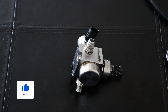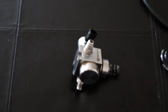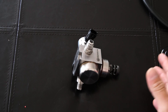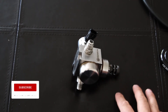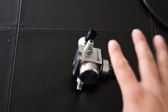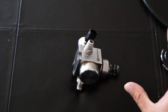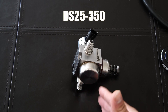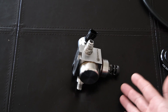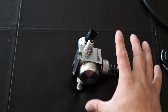One product I want to mention that was kind of unexpected is the high pressure fuel pump for the Gen 2 B58. It's significant because from the moment the Supra came out nobody has been able to make a high pressure fuel pump that will support that fuel system. The fuel system for the Gen 1 B58 runs on a 200 bar system — about 3,000 psi. The fuel system in the Supra and Gen 2 cars is a 350 bar fuel system, around 5,000 psi. That's why the new fuel pump for Gen 2 is called the DS25 350 — operating at 350 bar. It is plug and play and will include high pressure fuel lines.